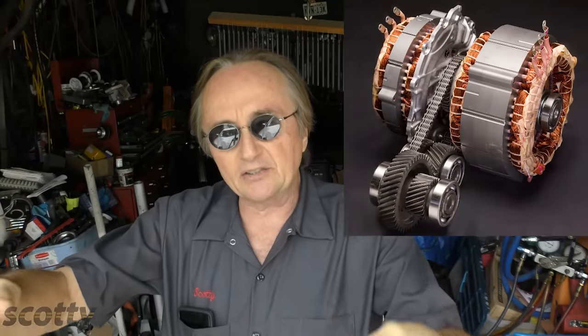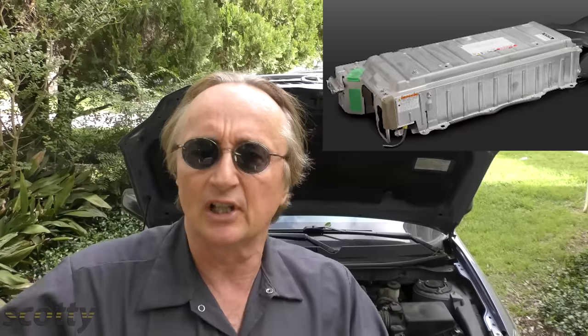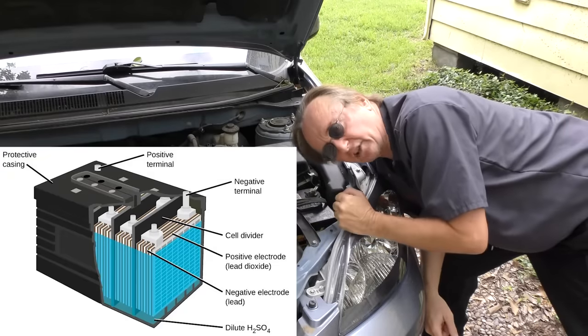They really started full-time in modern hybrid cars like the Toyota Prius. Auto start-stop works great in hybrid cars because they were designed that way. A hybrid car doesn't have a tiny little starter like a normal car that runs on 12 volts — it uses the generators inside the car to actually start the engine using a 500-volt battery, so it's no problem for that giant battery in the trunk of the Prius to start the car up and down repeatedly. It's got a lot of power. But most cars still have lead-acid batteries.